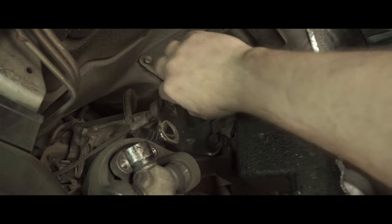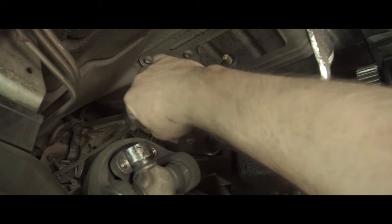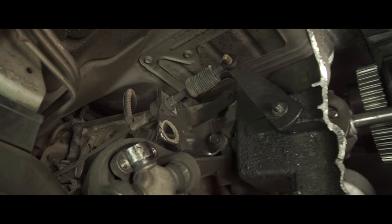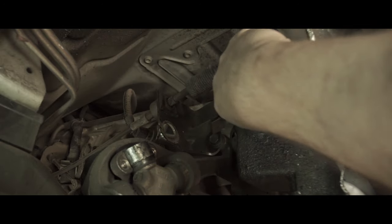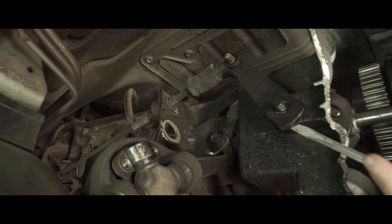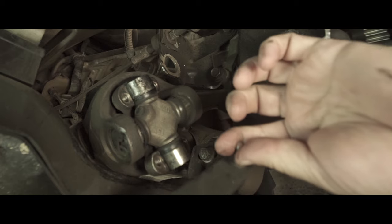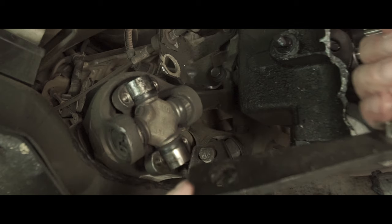This is a lock right here — you just pry this off, and then once this is disconnected you can just slip this out through this hole, put the lock bracket back on. It's designed for this cable to come through to the short connector. The transfer case I got didn't even come with the shifting lever, so I've got to see how it'll work. Looking at it now — it looks like it might have the groove that the lever goes into. Prying this out without getting oil in my eye — yep, looks like it'll work. The lever here hopefully will go onto the transfer case outside with this groove, around the groove on the outside, and yep, it'll work.